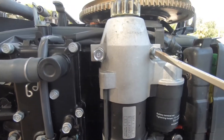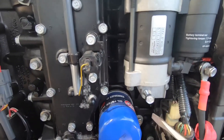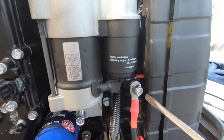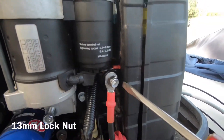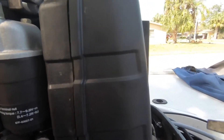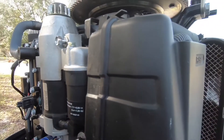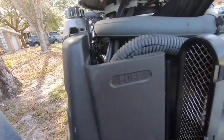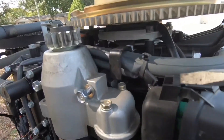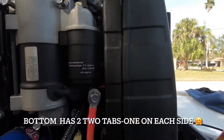We've got three main bolts to remove this starter — two up here and then one down here. We've also got this main power bolt that needs to come off, and there's a wire that needs to come off in this fuse panel.